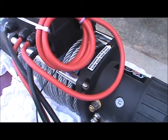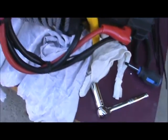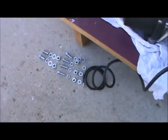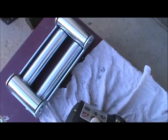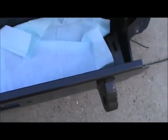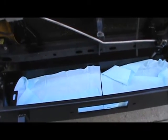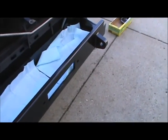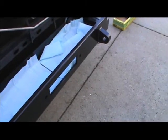You've also got your red lead, which is going to the battery as well. I've got it all wired up now, connections on, and tied together to keep it nice and neat. I laid out all my mounting hardware to make sure it's all here. I've got my roller fairlead there, and I put some paper towels inside the bumper tray so I'm not scratching it up as I get the winch in place. Once it's in place, I just lift it up and pull the towel out. I'll go ahead and mount the roller fairlead, then I'll be ready to put the winch in.